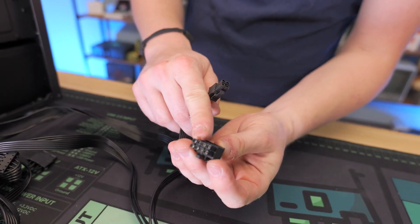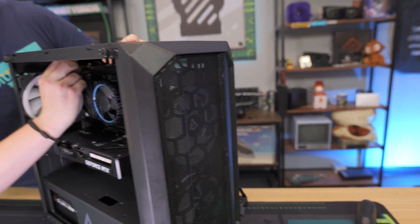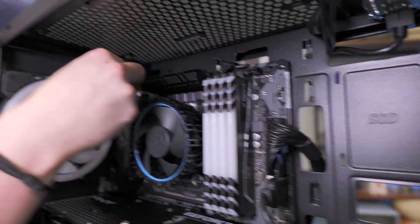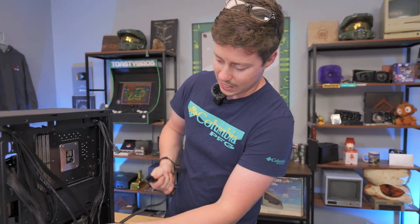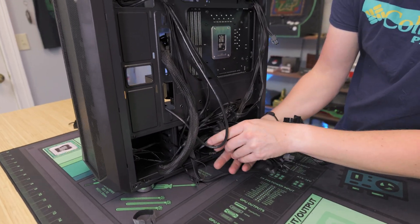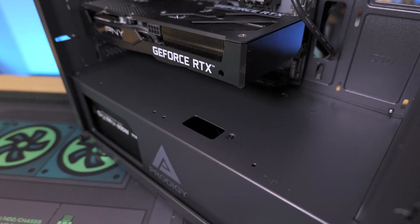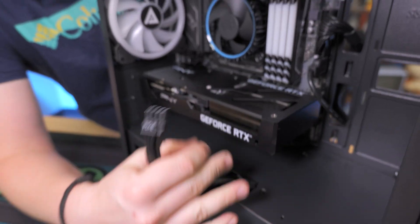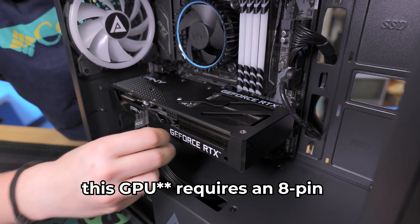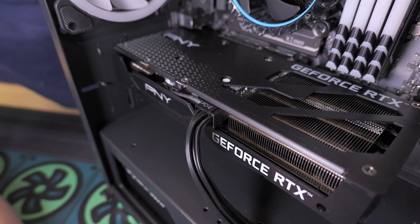Also 99% of the time the PCIe cable will be labeled 'PCIe,' so that's another really good indicator. It'll only go in one way and you get a nice audible click — you know it's in there. You can even tug on it to really make sure. And then we just need to run our cable for the graphics card. This Apivia Prodigy has a little cutout which can be very hard to get to once you have all the cables in here. We got our 8-pin through — that's what this power supply requires. Nice click sound, it'll go in there. You know it's not going to come undone.